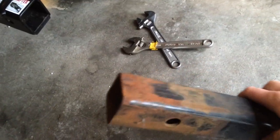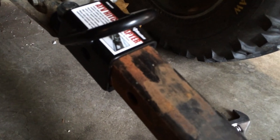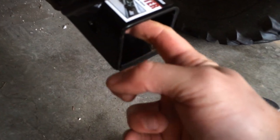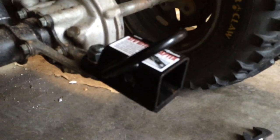This is a 2 inch receiver and this is the 2 inch trailer hitch that goes into it — very standard, I've used this on several vehicles. But it doesn't go all the way in. There's a little casting divot and some little nubs from the welds that are hitting. I know I can knock them off, but that's annoying. You get what you pay for, so if you're willing to deal with that — be aware.